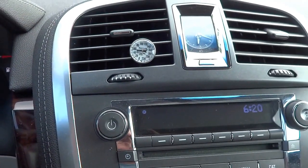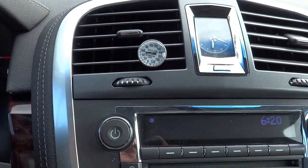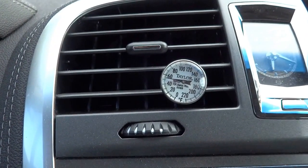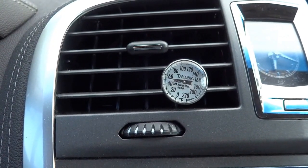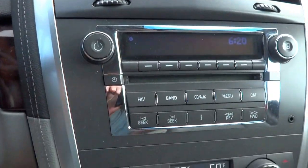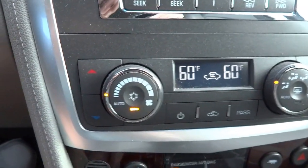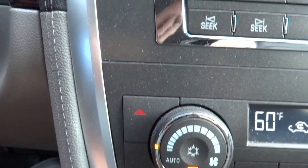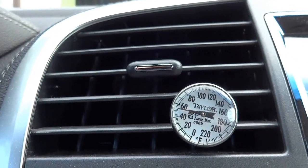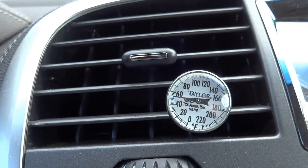This is just a simplified version of how to do a car air conditioning performance test. You can grab your meat thermometer out of your kitchen, stick it in your vent, close all of the other vents except the center vent, make sure your AC is on the lowest possible temperature setting, and put your blower on the lowest speed — this will produce the coldest air. Then you can compare your results with a range of about 40 to 50 degrees. Thank you for watching.